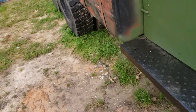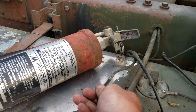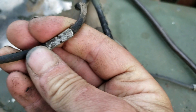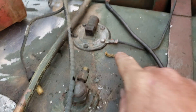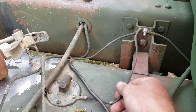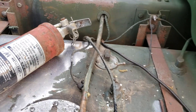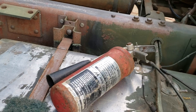You can do the same thing over at your fuel level sender — I'll show you that. Since the fuel level senders are so horrendously unreliable on these trucks, it's a good idea to add a dedicated ground anyway. I added a ground just to the body or frame there and it worked for a couple of days, then I added another ground from that straight to the ground post on the battery and it worked once again for a couple of days — and now it hasn't worked in forever.